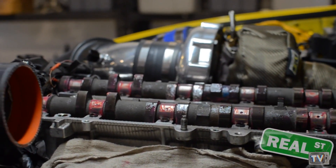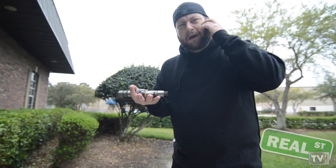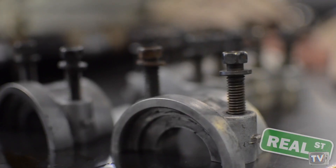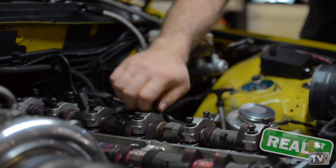There's more than one tutorial on the internet of how to put a 2JZ camshaft in, and we still get phone calls about people breaking them in half. Due to the length of the camshaft and the fact that the tappets are already in the head, you are compressing the valve springs when you tighten the camshaft back down in the head. So you need to be careful that you're doing it evenly.